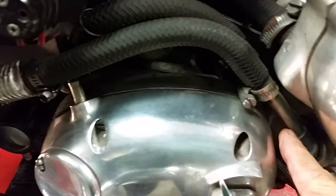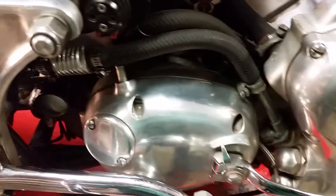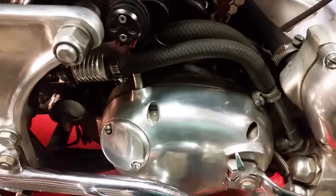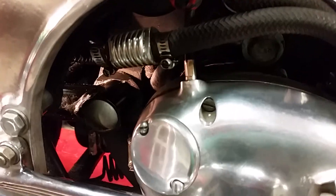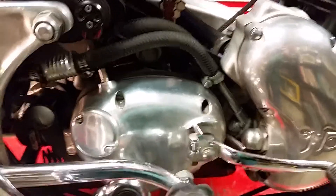Here's the deal: at the bottom of the tank, in that line, you put the anti-sump valve. It goes on the inlet side of the pump, so it uses pump suction to open the valve and let oil into the engine. The valve is seated by a very light spring so that oil does not flow from the tank directly into the engine.